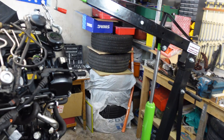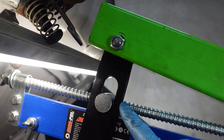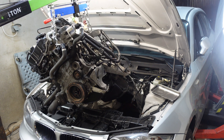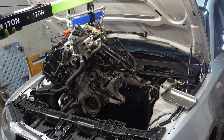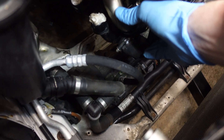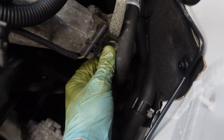I've got the engine on the engine hoist and I have to make sure it's as close as possible to the balancer because I don't have a lot of clearance here. I've decided to mount the balancer directly through the hole in the hoist. Now I can start lowering the engine into the engine bay. At the front I have to make sure that the engine clears the AC lines — and it looks like it's going to go well. I also have to make sure that this support arm clears the lines here, and it looks like it's going to go well.